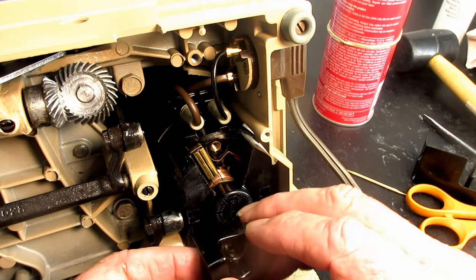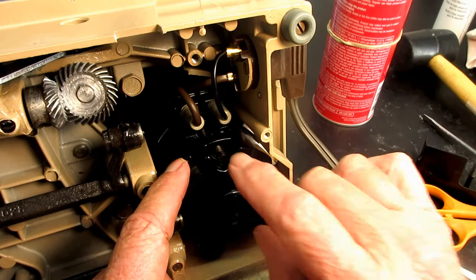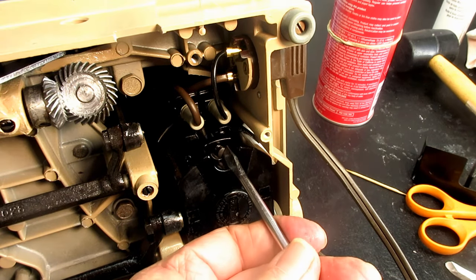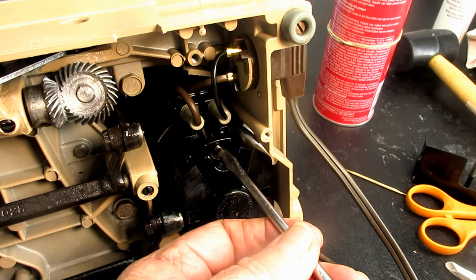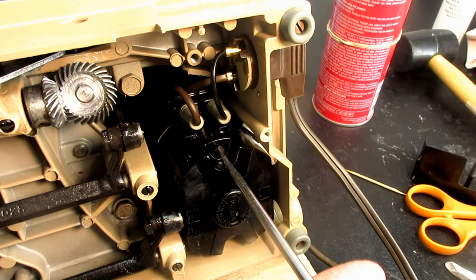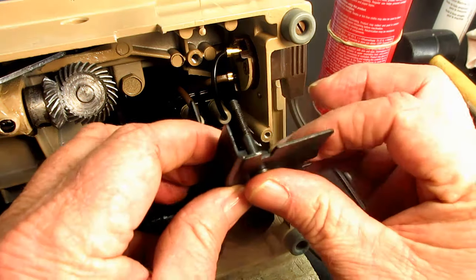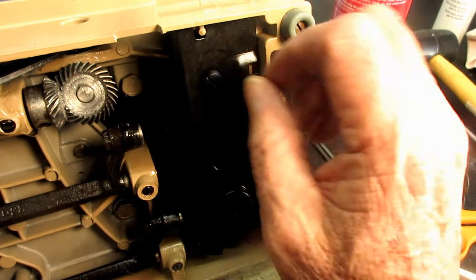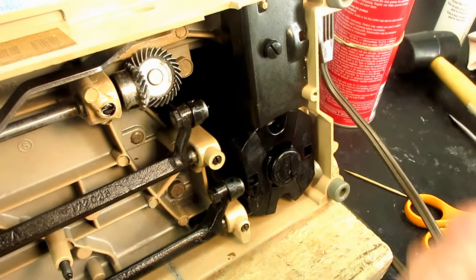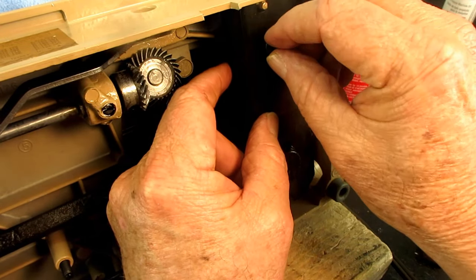Okay. Anyway, once you've seated the brushes like that, you just put it back together. I do kind of an annual tune-up on my wife's machines, wiping out old grease and oil and especially the grease and putting fresh grease on. And one of the things I do now that I learned about this method is I reseat the brushes on her motor. And she always comments on that, like, wow, I can sew faster than before you did that. I say, yeah, that's cool, right? That's the idea. Keep it nice and clean and running very well.